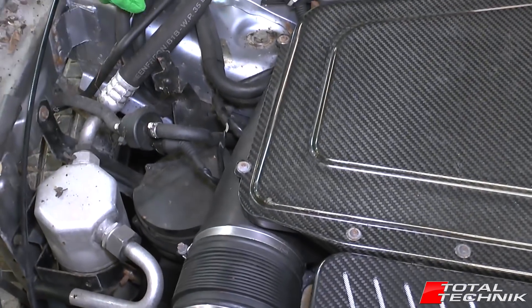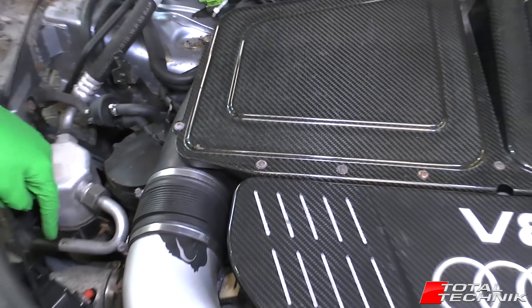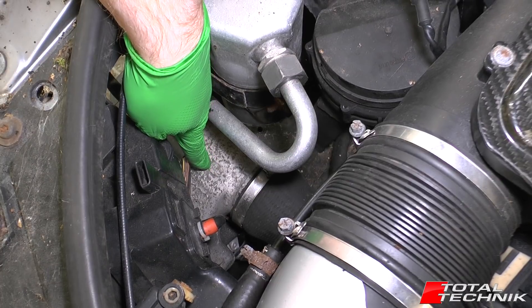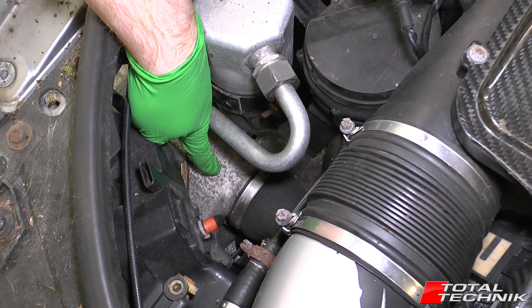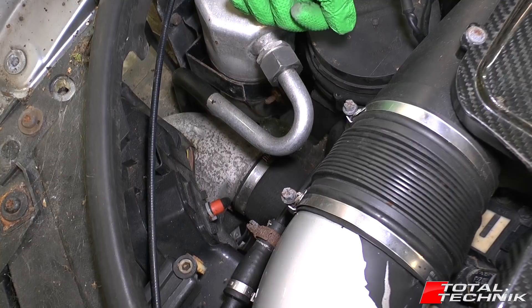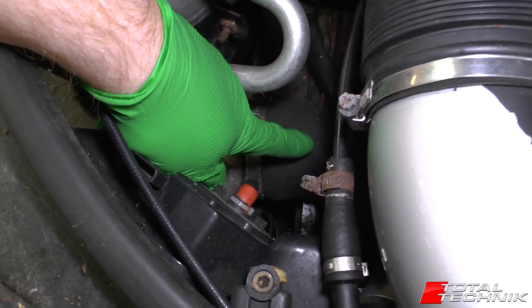You've got your air con system just here — the air con filler and bleeds are in here. You can follow those through the wall and you've got the air con containers down there. Just below that in the bottom corner you can just see the tops of the intercoolers. On the RS6 these can be one of the common items that do tend to go faulty. Unlike some intercoolers these are air rather than fluid filled, so it's a little bit harder — if you've got something like an Audi S4 where they're filled with coolant, a leak is easy to spot from the red G12 coolant stains. It's a lot harder on these because they are air filled, and the hoses that come off the intercoolers very often perish so it's worth keeping an eye on those.